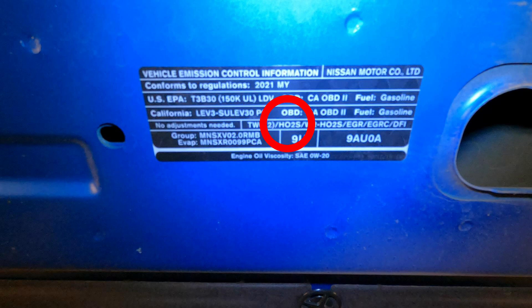This is a heated oxygen sensor — this will be the bank one sensor two, or the rear oxygen sensor on this vehicle. This one monitors the catalytic converter. Next listed is the wide range heated oxygen sensor. This is your bank one sensor one oxygen sensor, the most important oxygen sensor on the vehicle. It tells the computer how much fuel to give or take away to give you the best air to fuel ratio.